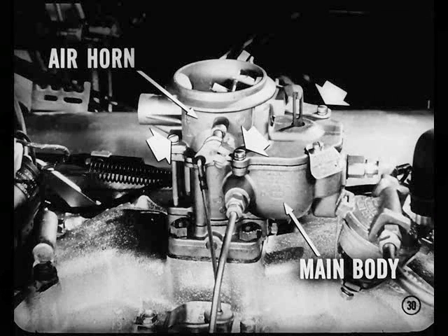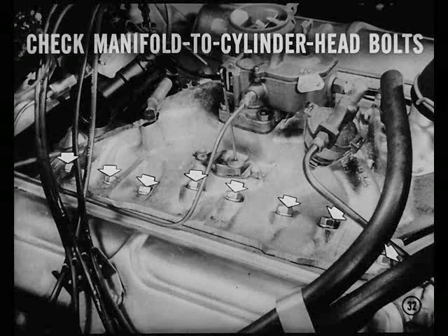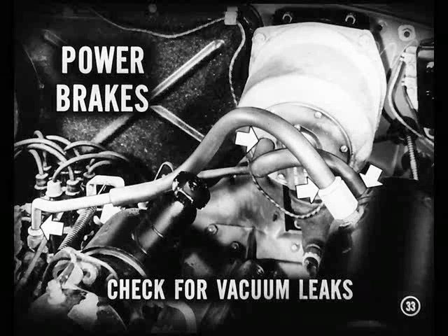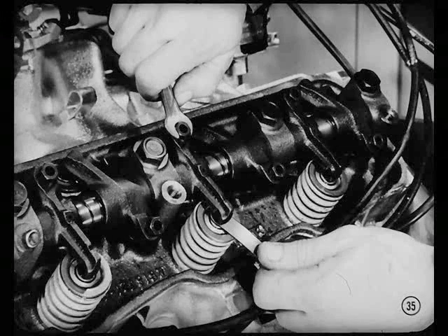Check for air leaks into the intake system — the screws that hold the carburetor sections together, particularly those that hold the main body to the throttle body. Check the stud nuts holding the carburetor to the intake manifold to be sure they're tight. Also check the manifold to cylinder head attaching bolts to see that they're snug. Anything that admits air will upset the mixture ratio and cause a rough engine idle. If the car's equipped with power brakes, check for vacuum leak at the hose connection on the intake manifold and the brake unit. The brake pedal linkage might be improperly adjusted, holding the vacuum intake valve partially open. If the engine uses mechanical tappets, check valve lash to see if it's up to specifications, as that needs to be right before idle will be smooth.